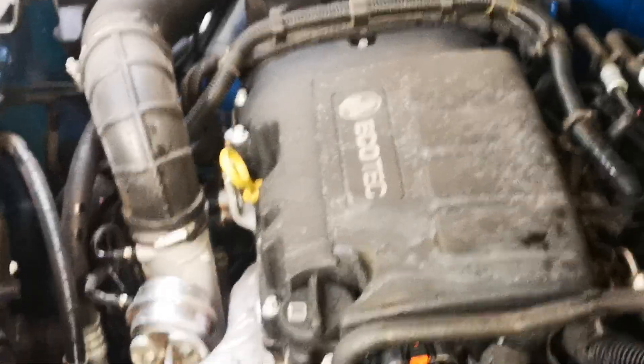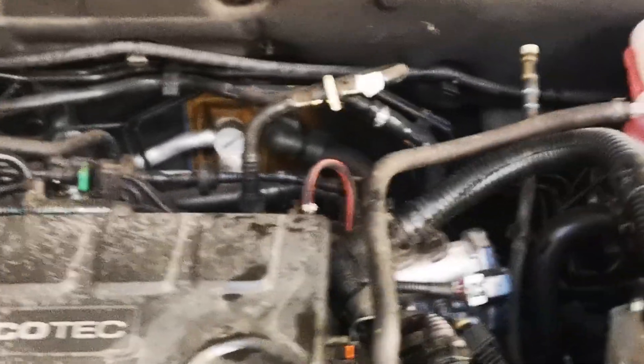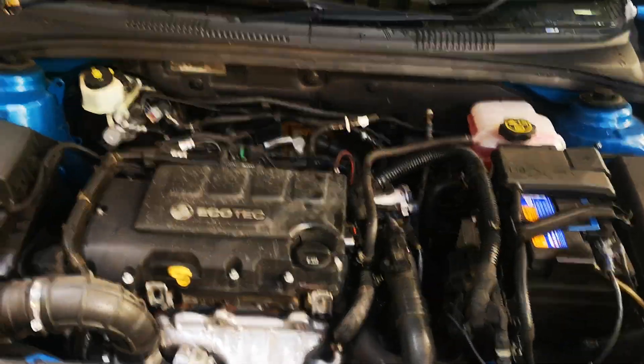If you don't want to bother with it, run it with the lid off. Take your time. Always make sure both the top and bottom hoses are hot. Now in this case, this bottom hose is hot, but I know this car's got an airlock. And yeah, you can run it with the cap off to bleed the system eventually, otherwise you have to open that little cap.